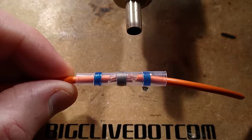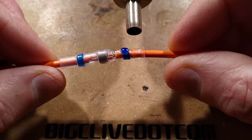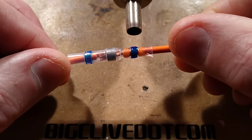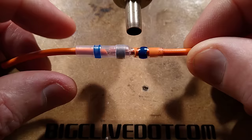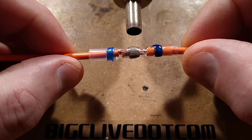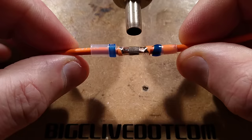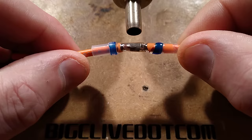Let's do that. I shall rotate it in front of the hot air gun here, which is currently set to about 300 degrees Celsius. I want to actually use it at that low temperature just to see if it does actually work with the solder. So that's kind of done - let's just move on to the solder now and see what happens. I shall rotate this in front of the heat, and it is melting - that's pretty interesting. It's flowing in amongst the copper strands. I don't see any sort of liquidy flux as such, but I do see what looks like proper mating onto the copper.